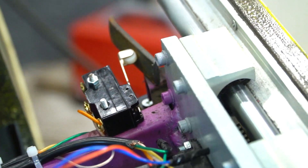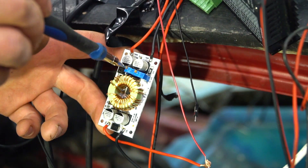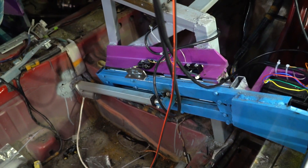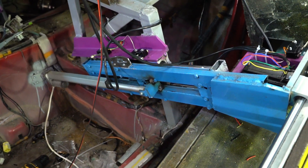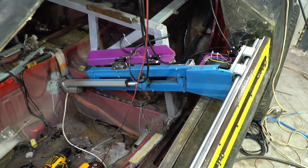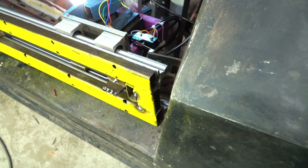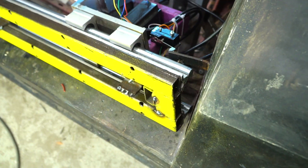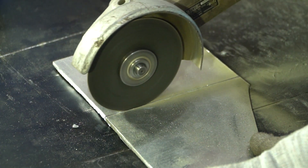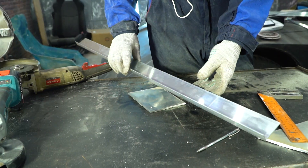Now everything works from the 12 volts in vehicle network. I decided to speed up the actuator by raising the voltage to 20 volts — it opens more lively. But there appeared an unstable work of the entire mechanism, most likely caused by this bunch of wires. 90% of problems turn up due to this. Since it all works nevertheless, I decided to make everything neatly and separate the platforms into boxes and also make some cable management.